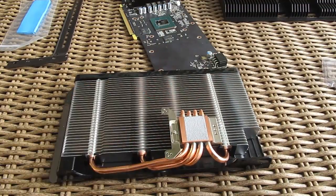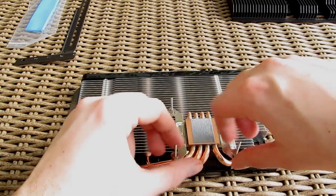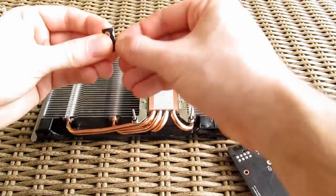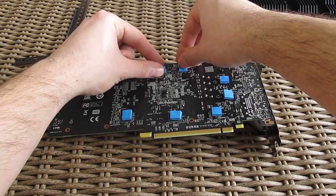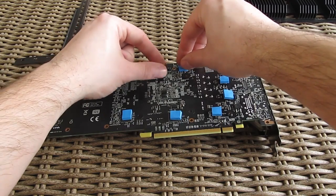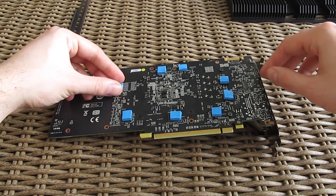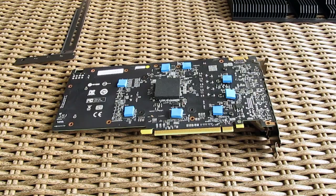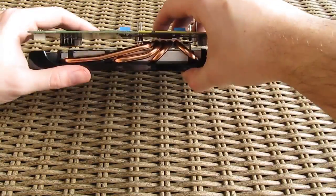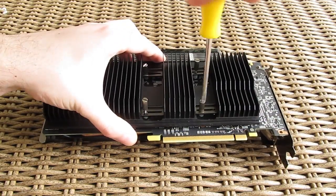Depending on the graphics card, you have to choose between two different brackets, and once you're done with that you have to put the long installation screws and standoffs on them. After that the next move is to go to the back side of the graphics card. We put thermal pads on a few spots like the VRAM chips, power regulation, and some other places to level off the backplate heatsink so it doesn't make direct contact with other components and possibly short-circuit something. Finally, we threaded the cooler through and screwed it to the other side of the graphics card, connected it up with the backplate, secured it down, and that was pretty much it.